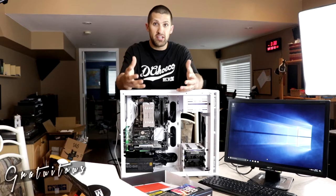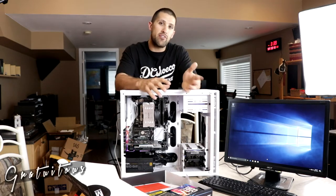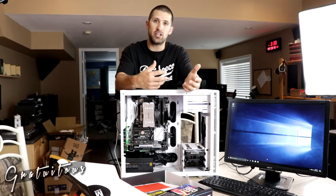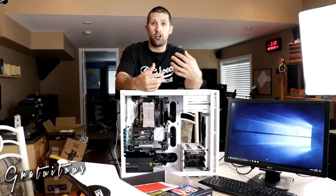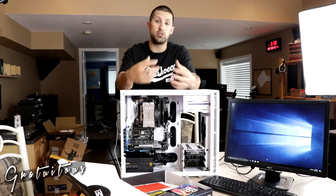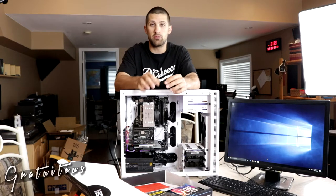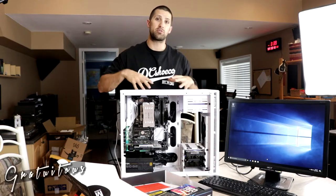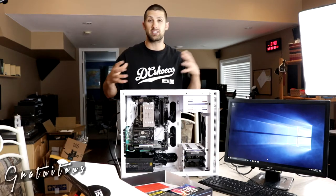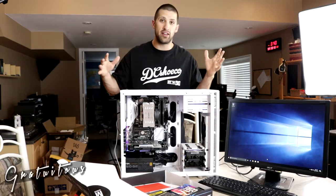Hey, welcome to this video on building a computer for music production. This is the final finished build, so as you watch you'll see how I put most of this together. I use FL Studio for music production and they have a really helpful page specifying what makes a good computer, because music production is a lot harder on a CPU than even things like creating video games — it can't offload work to a video card, it's pretty much solely based on the CPU. Single core speed is the most important. I'll leave all the links in the description below, including Image Line and the products, and I'm also doing an article write-up. This is my first time building a computer, and as you can see it turned on — it works!